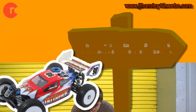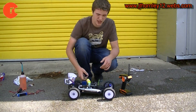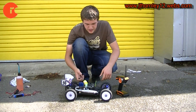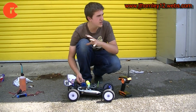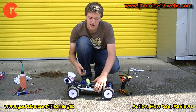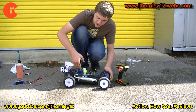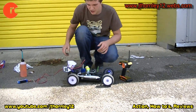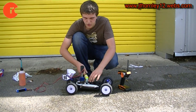Tank four. We just did tank three, ran very well. I just reprimed the engine and for tank four we need to go like half to three quarters throttle in straight lines, so we can start to have more fun. Prime the engine and just start it. It's very easy to get carried away and start going full throttle, but you need to contain it to the three quarters throttle.